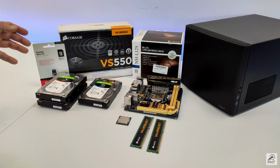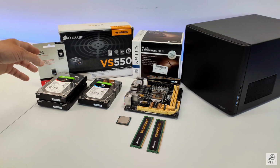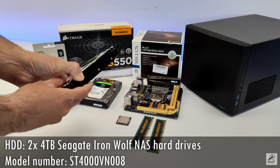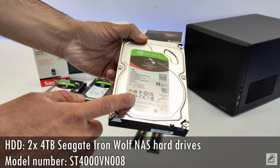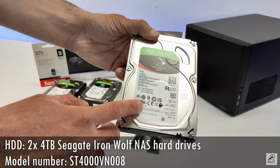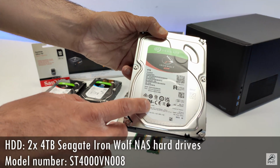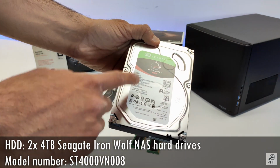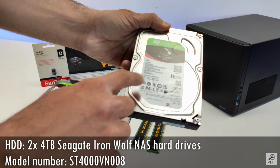Now, one of the other most important components is the hard drives themselves, and for this build I went with two 4TB Seagate IronWolf NAS hard drives, bought new. You don't want to skimp on hard drives when building a NAS. Especially if you buy old drives, you're never quite sure how they were used and if they have any bad sectors. Okay, you can run some tests, but it's always best to buy hard drives new because they also then come with warranty. I'll put the exact part numbers in the description.